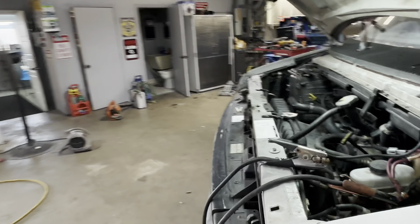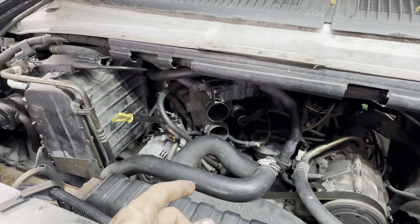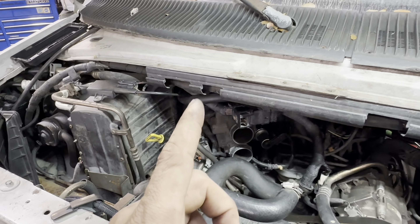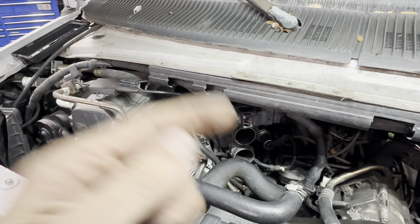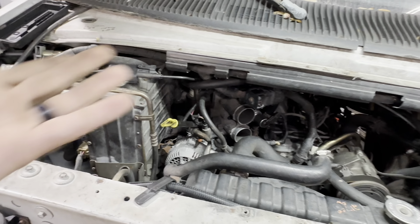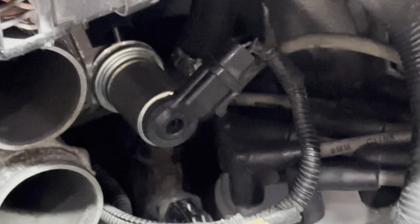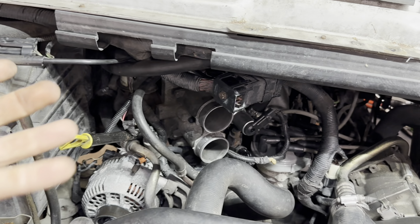While I was tinkering with this unit, I pulled the idle air control solenoid off. The IAC had no seal in it — it was just running wide open. The little rotating shaft that runs the seal up and down was seized in position. I attempted to actuate it electronically with some jumper leads and it was just a dead shorted unit. So I went ahead and ordered an idle air control. That helped but did not solve the problem — now it at least runs for longer before it shuts down.